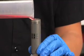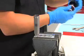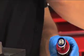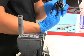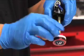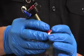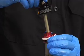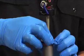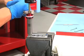Pour in new 2.5 weight oil until it's level with the top of the shock body. Adjust the gate to the full open or unlocked position. Using a 1.5 millimeter hex wrench, depress the poppet valve at the bottom of the shaft assembly. This will ensure oil entry to the shaft — the poppet should not remain open. Check to make sure all damping adjustments are set to fully open. Slide the seal head down against the piston, then place it onto the shock body and thread the seal head and shaft assembly onto the shock body. You should see bubbles and oil come out of the bleed port on the seal head. Make sure not to push on the shaft or shaft eyelet, as this will displace too much oil out of the shock body. Using a torque wrench with a 17 millimeter crow's foot installed at a 90 degree angle, torque the shaft assembly to 250 inch-pounds.